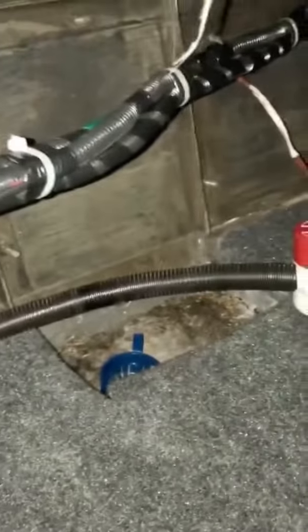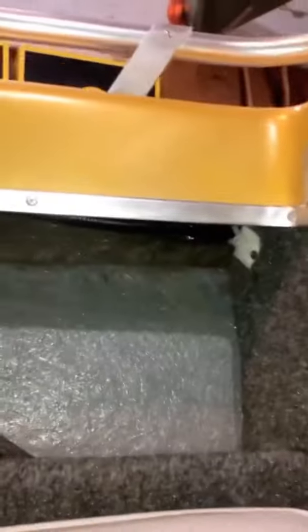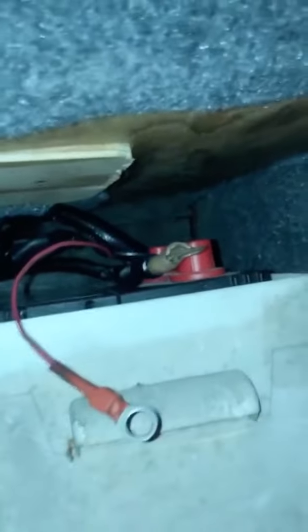All right, wiring is pretty much done on the back end. I have it all shielded up here through the wall there. That's the bilge pump that will clip into that bottom part. It runs up through here, tied into there. I also have the battery semi-hooked up. You can see I put shrink wrap on all the ends. Then those wires run through this gunnel. And then a switch I installed. That's just the main battery accessory shut off for the horn and fuse box and all that goody stuff.